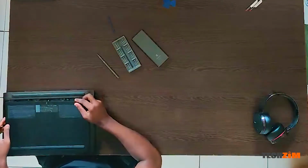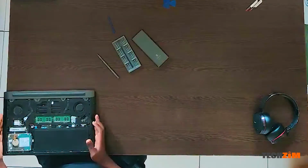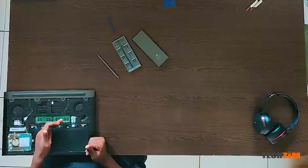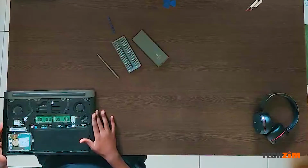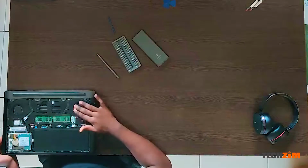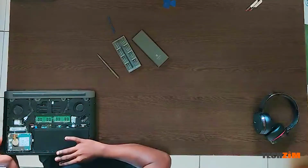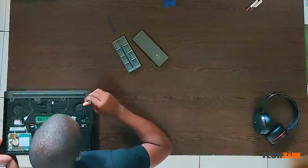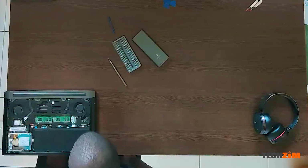The first time, that's when I realized, actually, yeah, sure, you've got one screw, you open that and you get access to the important things. So for example, your hard drive, your SSD, you can also switch your two RAM slots and your battery without opening any other extra screws. But if you want to do something more, change the keyboard, change the fans, change the thermal paste, you've got a whole puzzle to go through. So the puzzle is what we are going to be going through today.